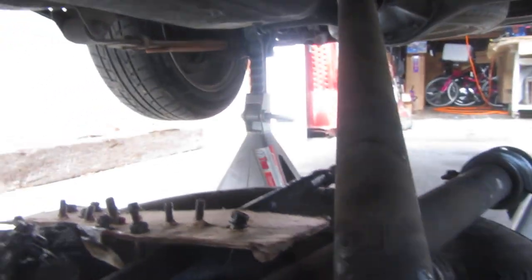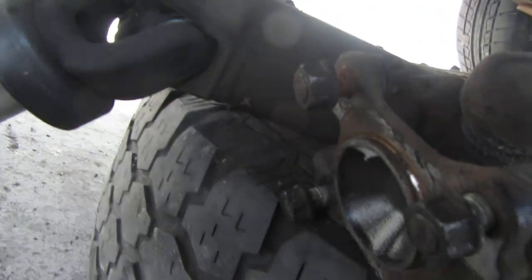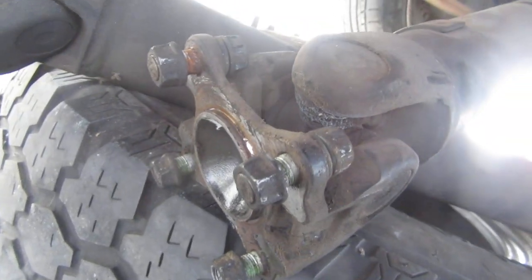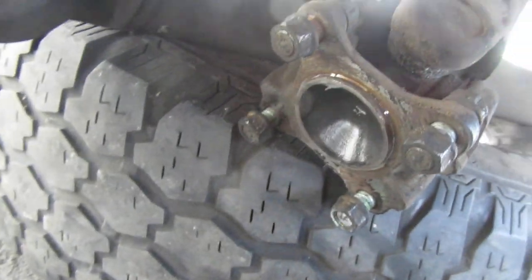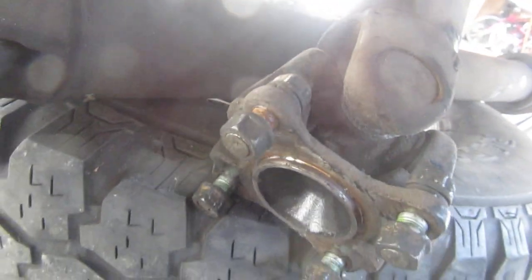The first thing you do when taking it apart — these drive shafts come off, so what I did was I painted the drive shaft so I'd know which way the indexing is. Painted it a couple days before, lifted it, painted it, then took it apart. I put all the nuts and bolts in exactly the direction they came out, heads in the correct direction, nuts and washers stacked — that's important to keep in mind.